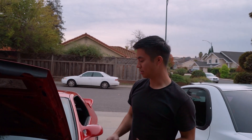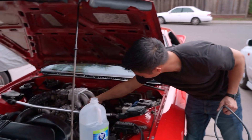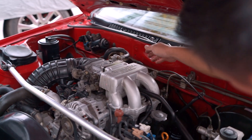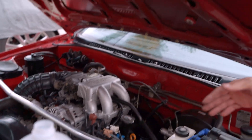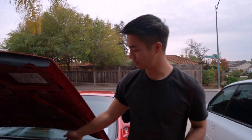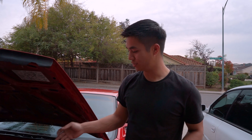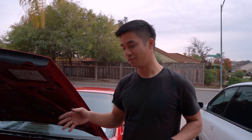For S5s, it's a little bit more complicated. There's one vacuum line here you could use, and there's another one back here you could use. This one would be for the front rotor, and this one would be for the rear rotor. We're going to do half a gallon of water sucking into the front rotor and then half a gallon into the rear rotor. When you do this, make sure you rev the car up to maybe 2,000–3,000 RPM and hold it there, because when it's sucking in water it will stumble a bit. You've got to give it some gas and keep it alive.